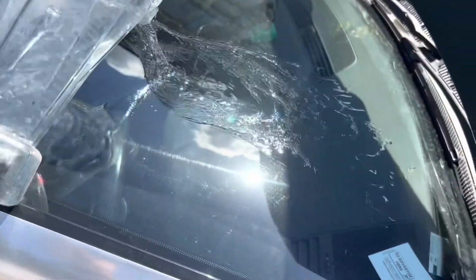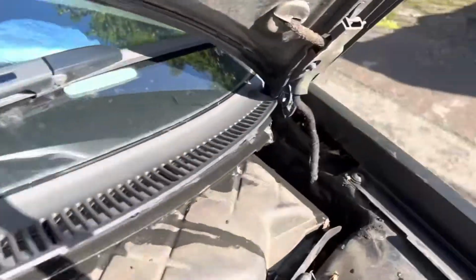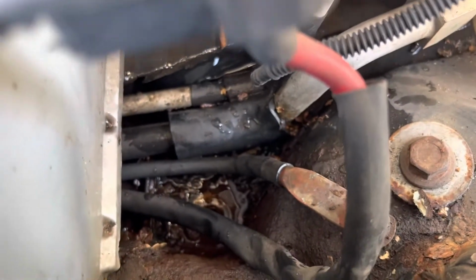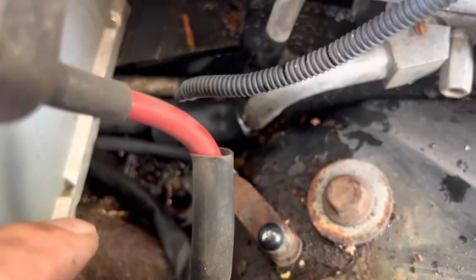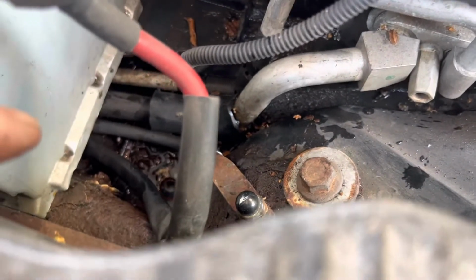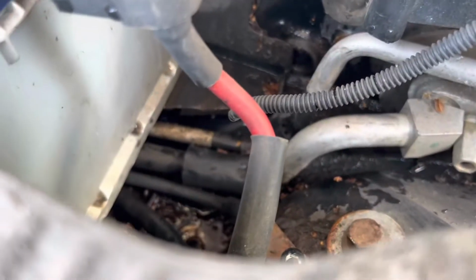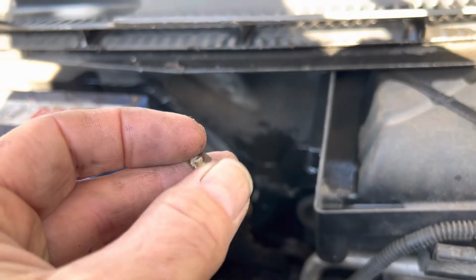When it rains, all the water coming off your windscreen is funneling down that one little drain hole there, either by rolling off into the sides and then down, but it all ends up down that hole there. You can see that if, like this car, you had masses of leaves and other bits of stuff in here, what happens is it gets washed down here, and if that drain hole gets blocked up, which it has been on this car, you'll get a pool of water sitting in the bottom there, and eventually things will start to rust.